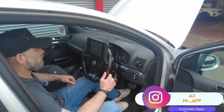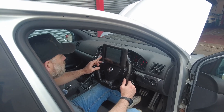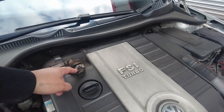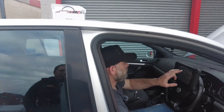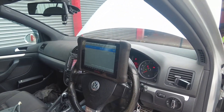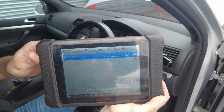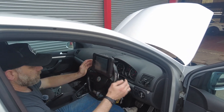Aaron has got the Autel, which is one of our more entry-level diagnostic tools that we use at work, but still a fab bit of kit. It's just plugging in — we're going to check the diagnostic codes on the engine. We have disconnected the air mass meter, which is just here, so we know it will throw up a fault code. P0100 — mass or volume air flow, no communication or signal. So we'll leave that and disconnect the Autel, then plug in our new eBay special.